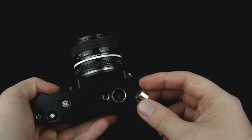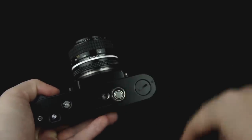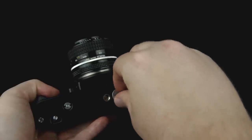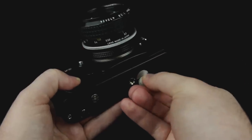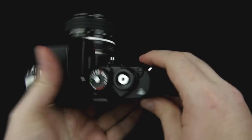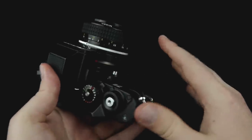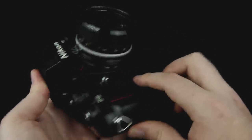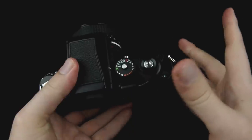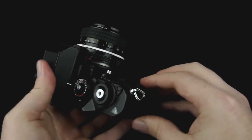This time I'm just using one battery instead of two. Positive side goes in the camera, negative side goes down. This camera cannot really be operated without the batteries. The batteries run the light meter, and they also run the shutter button — the shutter button itself is electronic. There is a way using this lever here to activate the shutter, and the winder will still work, so technically you can use it without a battery, but it's very limiting.